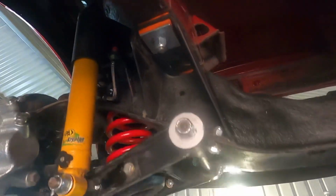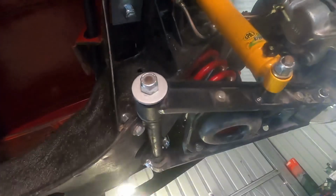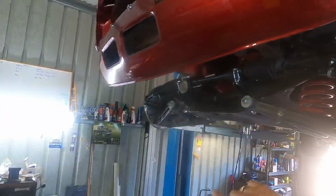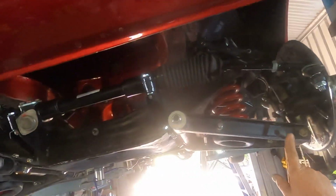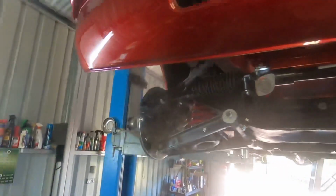Getting these bolts back in, right, the outside ones obviously are very easy, but the inside ones that I'd taken out when it went to the body shop, they were an absolute nightmare, because you've got to take all the suspension apart to get the bolt in through here. Well, it's got to go in through the spring hole, and then get tightened up through these two holes here. But getting those in was an absolute nightmare, because the front of the car wasn't heavy enough to take the weight of this, to push the springs up. So I had to get a crate of bricks and tie them to the crossmember to hold the car down while I jacked up one side to get the pinion bolts back in again. But that was a bit of a job.